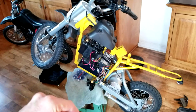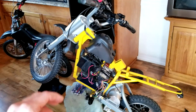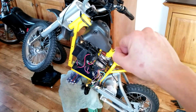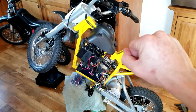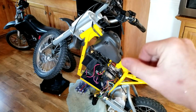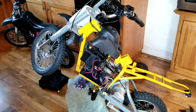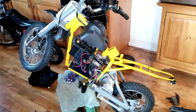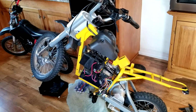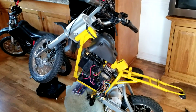So I was at the end of my ride, and typically I have a couple more blocks. What happens when the batteries are running out is you're throttling it and you're like, whoa, and then all of a sudden it'll cut power a little bit. It might jerk you a little bit, but it will still go, it just doesn't have enough kick, enough torque like it used to. That's when you know you're on your final leg of your batteries. I don't have a voltage meter quite yet, so that means get home and charge up, or if you are a couple miles away, definitely just slow throttle it and get yourself home.